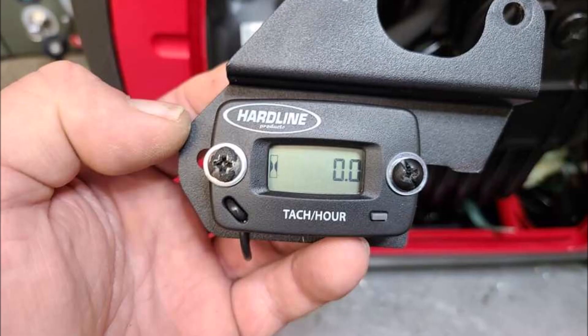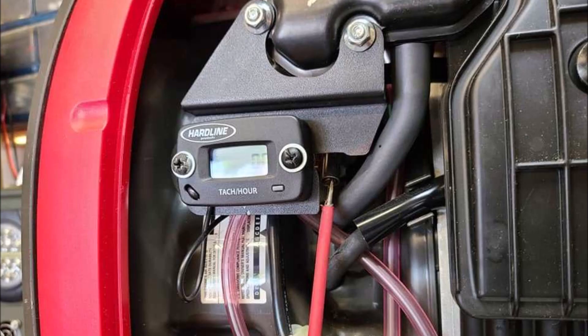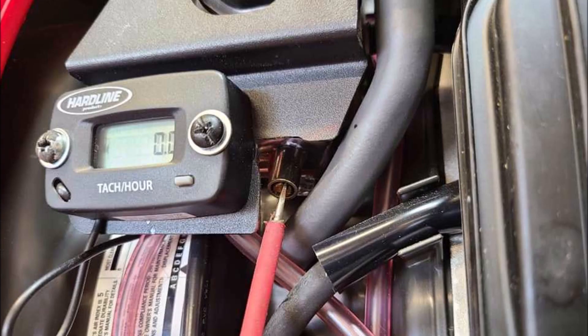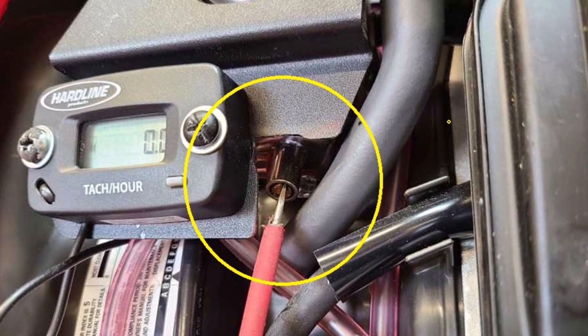And mounted the hardline to the bracket going straight through the eyelets on the unit for better fitment. I used nylock nuts so they don't vibrate off. And as you can see, now you can get to the petcock drain on the float carburetor. They say to do that after every use to keep carbon and crap building up in the carburetor. Here's a better view right there.